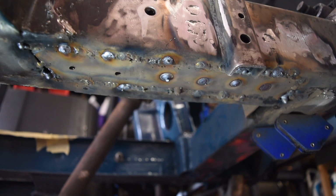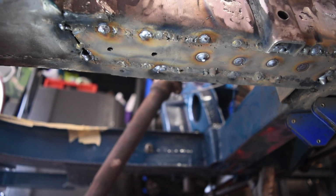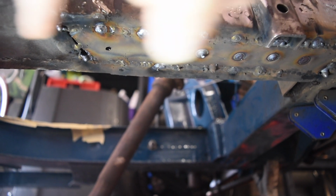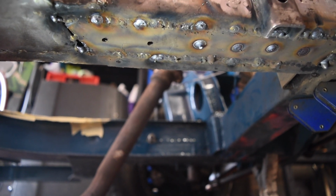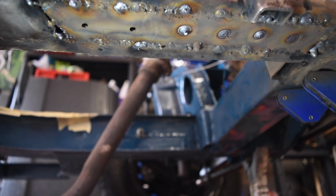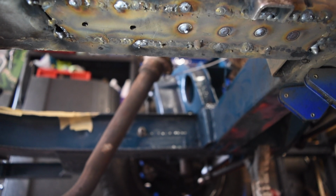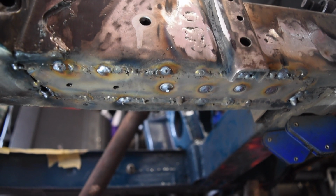And there it is, mostly welded. There's some places where I'm struggling, like here, because there's dirt inside, or well, probably wax oil inside. So I'm cutting the inside out, so I'm going to clean up there and either weld that from the inside or clean the back and then weld it from underneath or something. And you can see also here I've got a couple of porous welds, so I'm going to have to grind it all down and then redo some bits. So I'll get this ground, and then I'll do a bit of touch up and then start cutting apart the last bit.